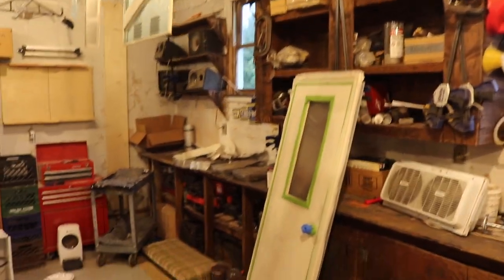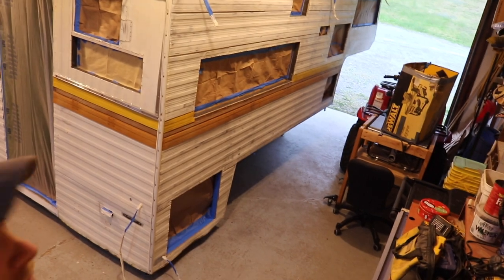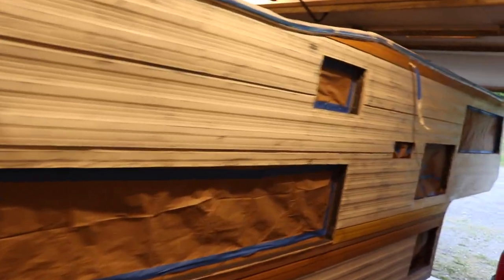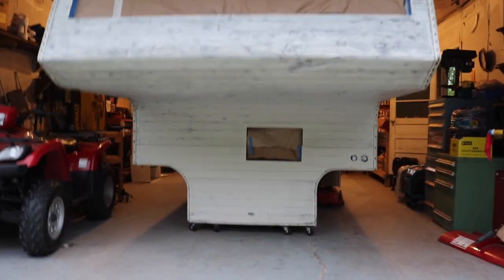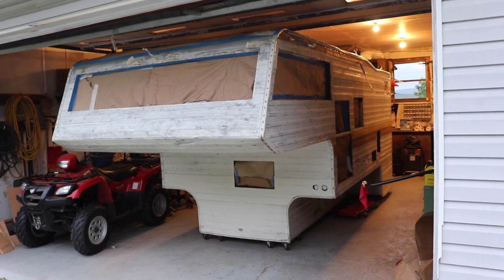Here's a look. Got the stuff all taped up. Got the other panels hanging, ready for paint. Prep work, baby, prep work. Very time consuming, all that taping and paper. You wouldn't think it, but it really is. So I'm going to pull the four wheeler out, put plastic on it in some places where I don't want overspray. Just prior to painting, I've got to wipe the whole thing down with alcohol, and then it's ready for paint. That's going to be in the next video.